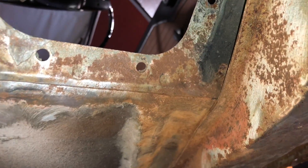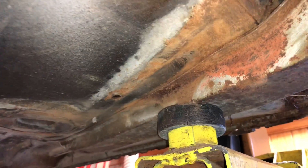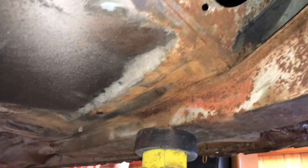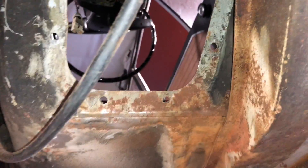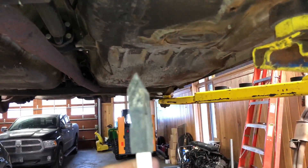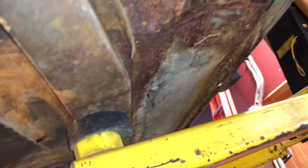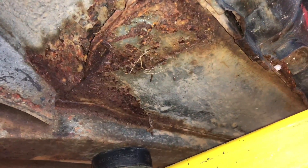This is the first time I've ever taken a wire wheel to rusty surfaces and actually been pleasantly surprised with what's underneath — basically nothing, just a little bit of outer crust surface rust. I can't really get this area with the rotary brush, so I'm going to use my manual wire brush, dig it out, dip it in some POR-15 and get going. I might find a little worse over here once I get the rotary brush going, but I'd like to at least get a preliminary coating on there so it doesn't oxidize any further.